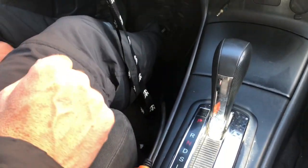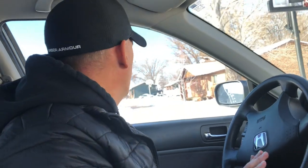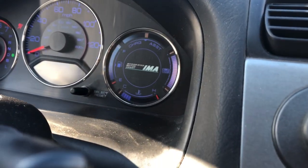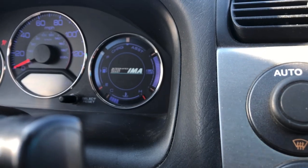If we were to take this in and have the emissions done on it right now, it would come up and say your oxygen sensor is not reset. So we've got to go for a drive. Here comes the trick: when we're driving, we want to keep our RPMs low enough that we do not get into the electric assist part of the engine. You've got to keep it down low enough that all you're using is the gas engine. Just feather the throttle real light on and off.